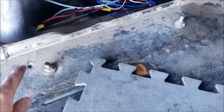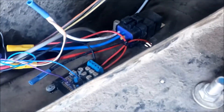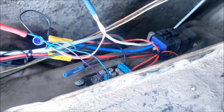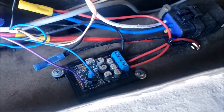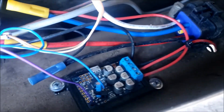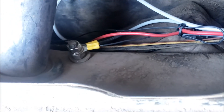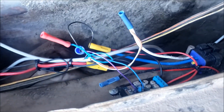We're in the back of the car. The battery is located underneath the studs, inside the fender. This is the remote relay we added a couple weeks ago. Main power comes into this red wire, comes up through a grommet next to the battery, tied off to the battery cutoff switch, and powers the relay. The blue wire is the power out of the relay, which gets looped into this 25-amp DC motor controller. The black wire is the ground to the motor, and this other black wire runs around and is tied off to the ground back here.